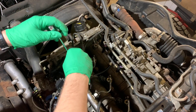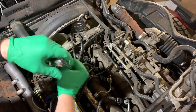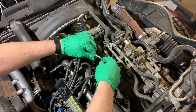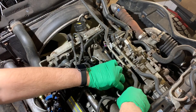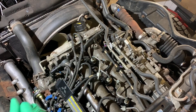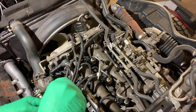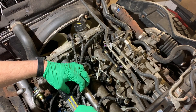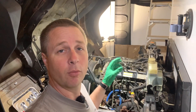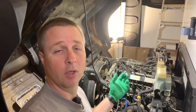Next you're going to want an 18 millimeter — loosen all of these off the rail itself. Now we want to relocate the lines away from the rail but keep them on the injectors. I need to get the fuel supply off. This is a little difficult because it's tight in between the wires. If you need a little bit more space, the wire bundle is clipped to the rail and can be pulled a little bit off to the side. I'm not actually going to remove the rail from the engine — I'm just going to separate it enough that I can get the pressure regulating valve slid out once it's loosened off in the front. This will save me from having to disconnect the fuel return line which comes all the way down to behind the filter.